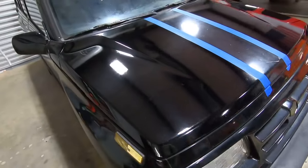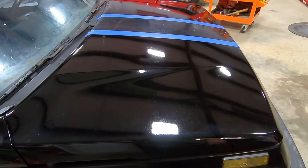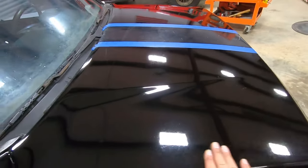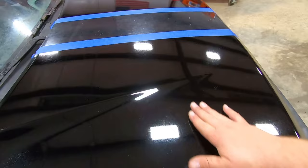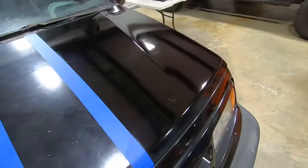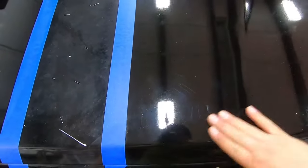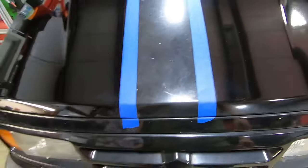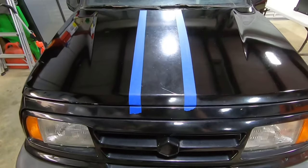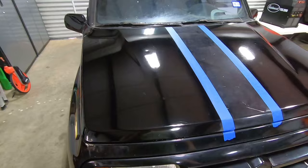In this section I'm going to do a voiceover because my mic messed up. On the left side of the hood we used the Ultimate Compound and the Ultimate Polish. You can still see the oxidation, but it turned out really nice considering we didn't wet sand it or clay bar it. On the right side we did just the Ultimate Polish — you can definitely see the right side has more oxidation than the left side. The left side has a deeper shine to it, and the right side has kind of a dull finish.